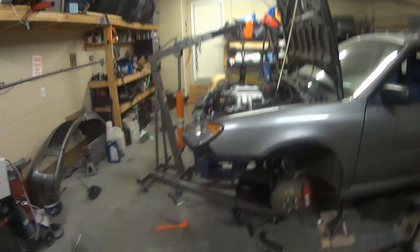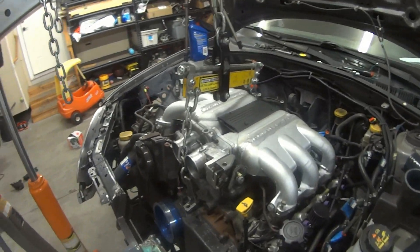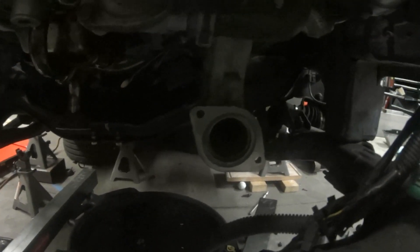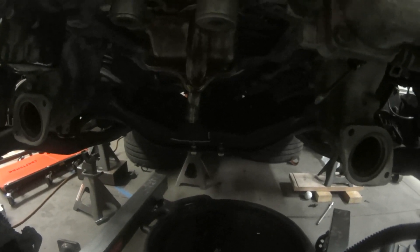I've been working on my turbo oil drain. It's going to go from my scavenge pump into the oil pan, and I've got a few tricks and words of advice for you. I'll start with what it takes to remove the oil pan on your EG33 Impreza — and I believe this also applies to the SVX. You can see I've got my engine attached to the crane here, because I had to pull the engine mounts out in order to get the back three bolts of the oil pan off. There's basically two inches that I had to lift the engine to access those bolts.